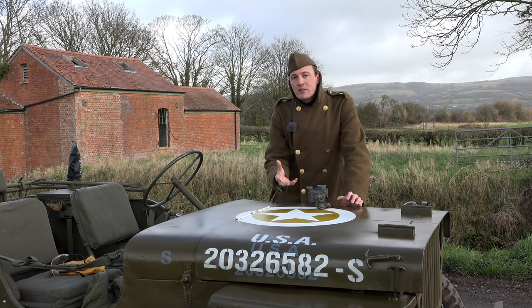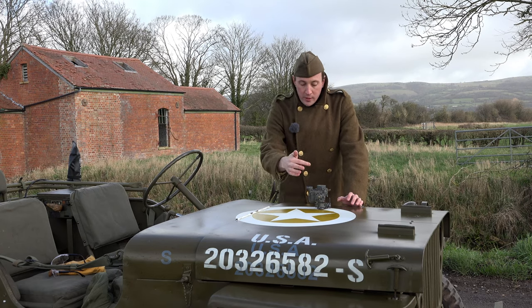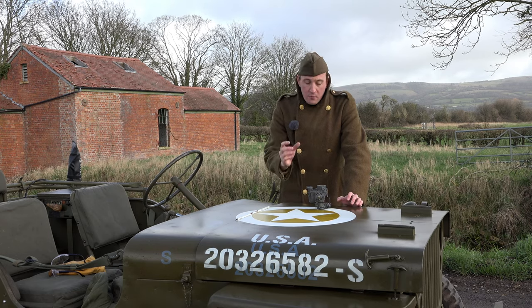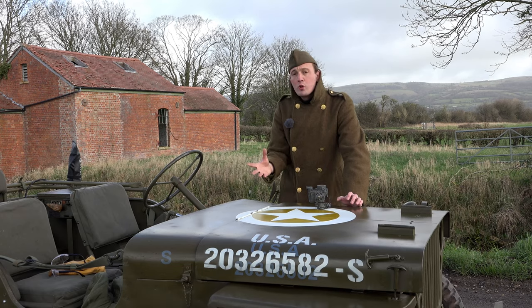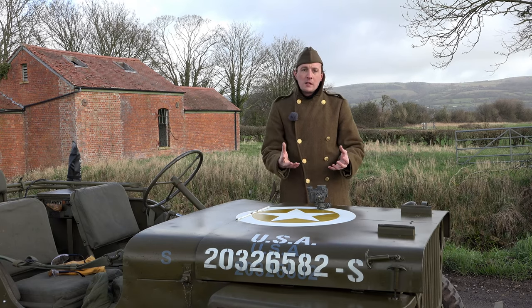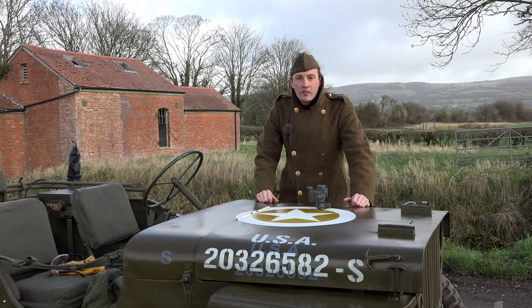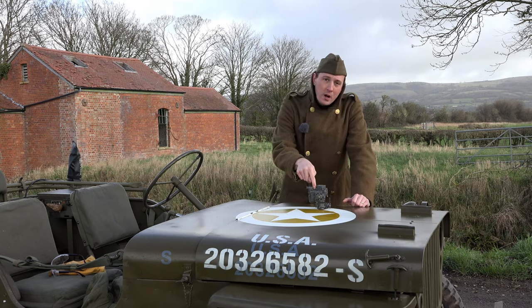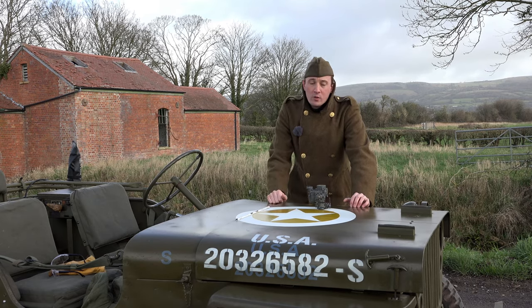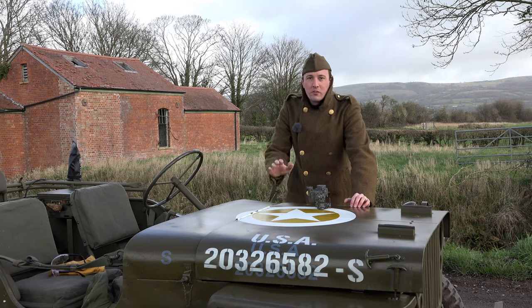Overall though, the WO is made to be a military carburetor — it's dust-proof. These are not; that came later with the 32 PBIC. So dirty air can get sucked in and clog them up. But really, really pleased to use these rare carburetors — things which haven't been used in God knows how many years — to resurrect them and bring them back to life. I hope you are too. Like and subscribe, join me on Patreon, and we'll play with more stuff next time. I'm going to keep this on my jeep and drive it for a long time — give this old girl another lease of life. She deserves it.